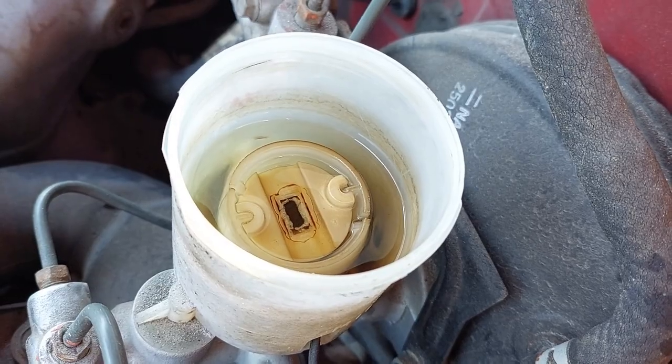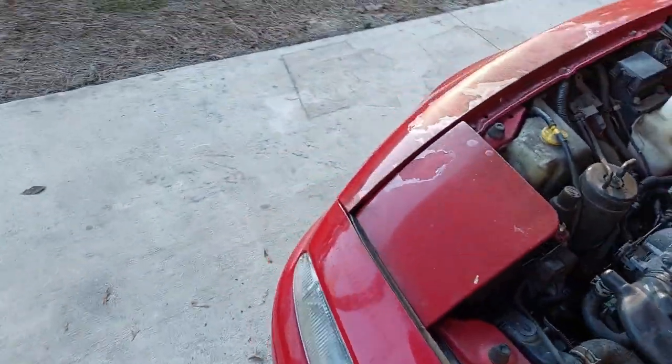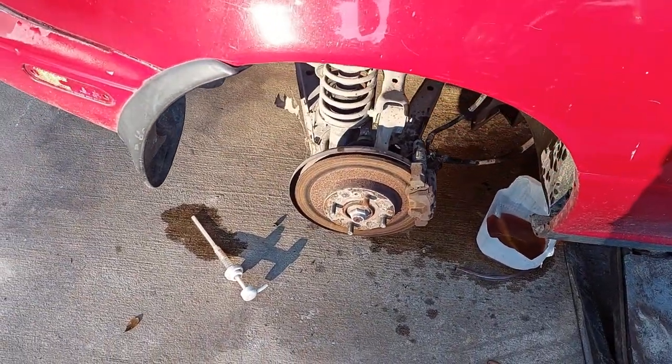If you're doing normal brake bleeding operations, top off as you go until you've cleared all four wheels. Another thing: when you do this, you want to start with the wheel that's the furthest away from the master cylinder, which is why we've been working here at the rear right.